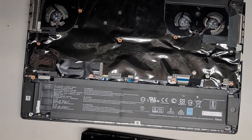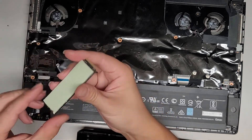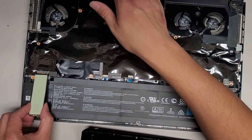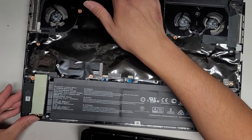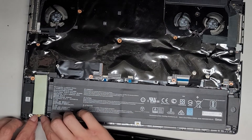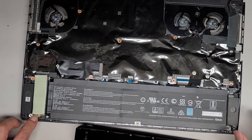The problem is they didn't provide the screw — I don't know what they did with it. Anyway, I just lifted this off; it's a Samsung 980 Pro. We're going to get the SSD in here — just like this, it goes in slightly at an angle. Make sure it goes in all the way, and then this just drops down. Again, there should be a screw here, so I'm going to see if I have a screw that will fit because they're missing the screw.